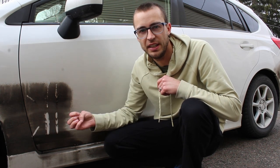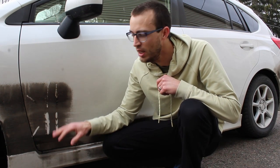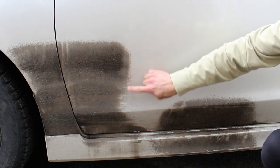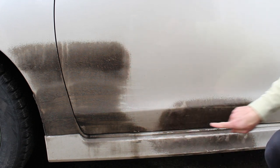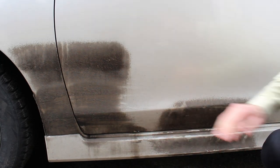When you use something that hardens or turns into a waxy material, if it gets chipped it doesn't self-heal, and rust can start to form in those locations — and it also usually creeps underneath the materials. Something that's wet and doesn't come off is much better than something that hardens. Up here, this area is the Surface Shield, this area right here is the Fluid Film, and over here I did Surface Shield as well so it was at the same level as the other two. You can see they both held up very well.